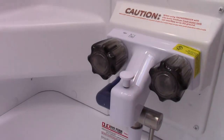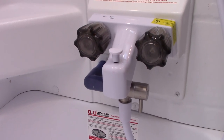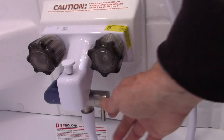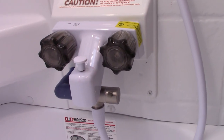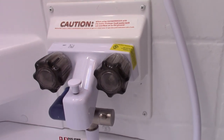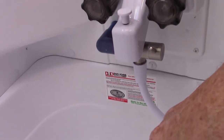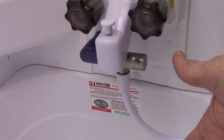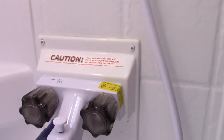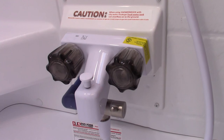This device here is called a water miser — it's a water recirculator. When you turn on your hot water for the shower, normally you'd just be running water down the drain until it got hot. If you're in an area with drought problems or using onboard water and don't want to waste it, that's wasteful. When water goes down that drain, it also fills your gray tank unnecessarily. What this circulator does is send the hot water around in a loop — nothing goes down the drain and nothing more is drawn from the tank.